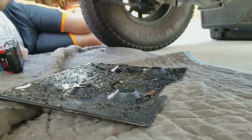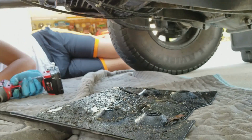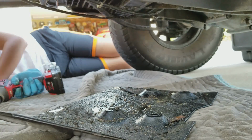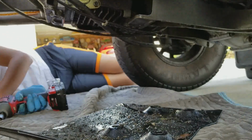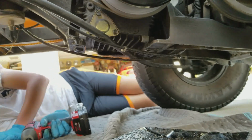They can come off anytime, because what I've read in my researching this project is to place a jack underneath the motor, and then release the other 4 bolts, the 2 in the front and the 2 that are in the rear. So that's what I am going to do.